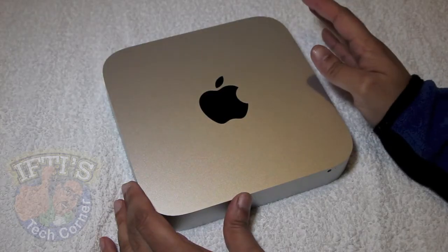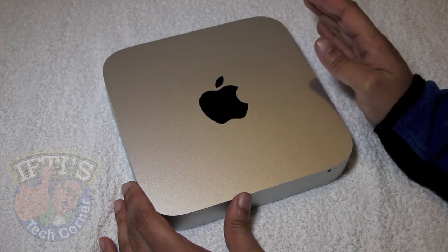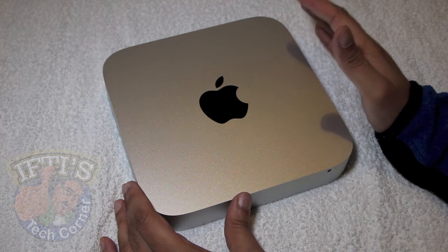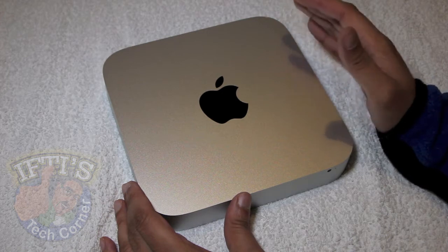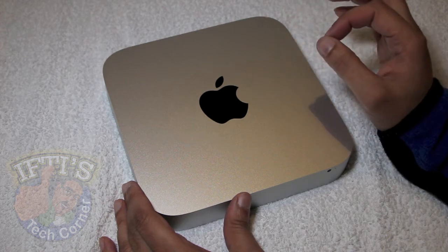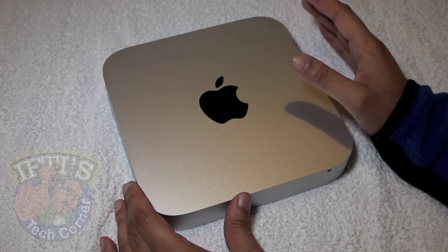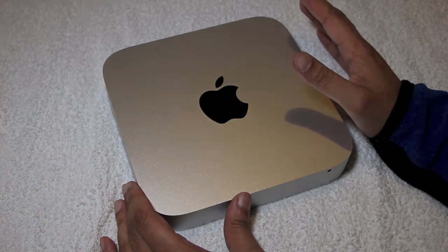With the RAM upgrade now complete, it's probably a good chance to switch the unit on, hold down the D button on your keyboard and perform a full hardware test just to double check the RAM and make sure it's working okay. As long as the check passes, you are good to go.